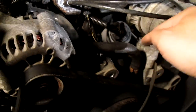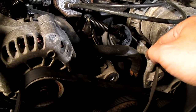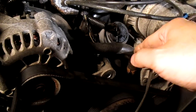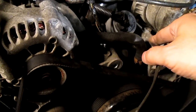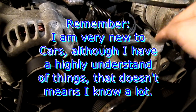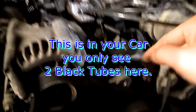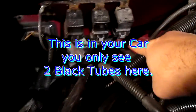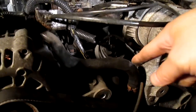The problem is that because of the on-demand system, the engine is always running hot, and it gets hot inside the car too — even when you don't turn on your heat, that valve is open and heat is coming in. The manufacturer designed it this way for winter use, but in summer you don't need on-demand heat at all. You can see those two heater core pipes right there — they run to the engine, one connects to the water pump up here, and the other is a little below.